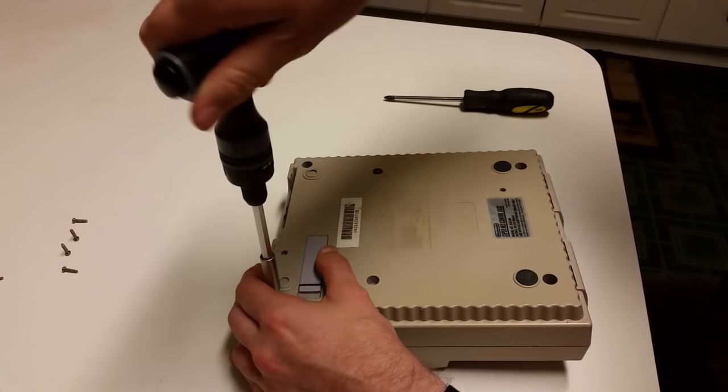So that's what happened. When I brought these home, both of these consoles, both of these Super Nintendos were giving me that no signal screen when I would power them on with a game inside and nothing. So I had to take both of them apart and clean the pin connectors. Pin connectors, that's all it was. They needed a deep cleaning. So there's that one.